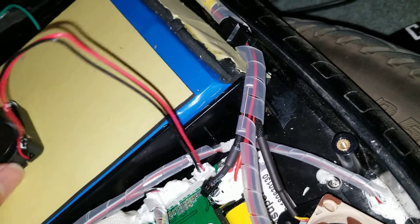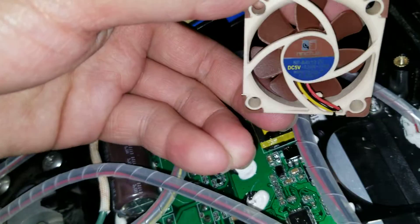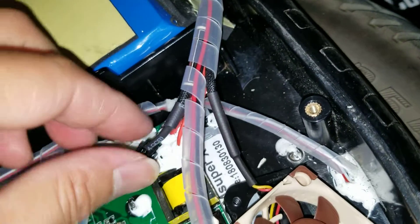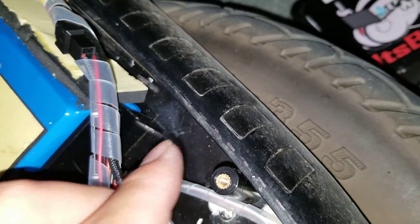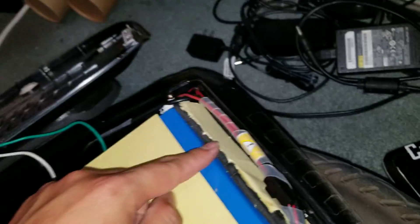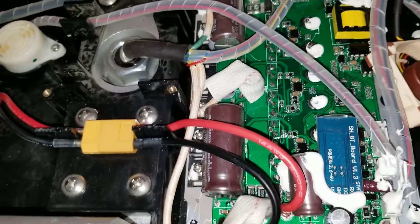I don't want my board to fry, so I might have to look into it. The original fan uses quite a bit more power — 0.15 amps — while the Noctua uses only 0.05 amps, so it's about a third of the power draw. It's probably not going to be as powerful, but we'll see. I feel a good amount of air. I'll just monitor the temperatures and hopefully nothing weird happens. It's pretty easy to replace — you just use the adapter to convert it to the two-pin connector. That's pretty much it, thanks for watching.